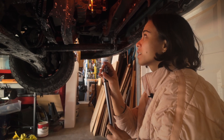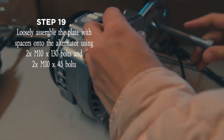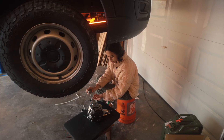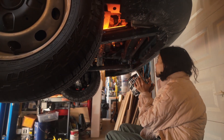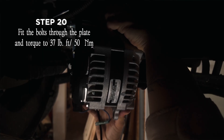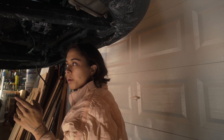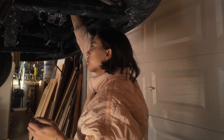I got those torqued to spec and now I'm putting the secondary alternator in. I loosely assembled the rear plate with spacers onto the alternator on the table, then held everything together to lift it up and install it — this can be difficult with one person because it is actually quite heavy. I added a little bit of never-seize on the bolts before putting it up. Once you get a couple bolts in, check that all spacers are correctly positioned, then tighten and torque all bolts to 37 foot-pounds. All the alternator bolts are 15 millimeters.